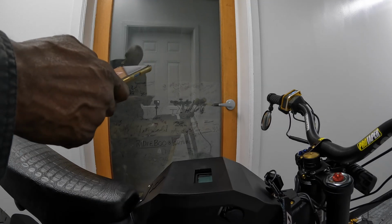Okay, we're connected. Okay, I gotta set max DC current. I got set to 280 amps. Max phase is 650 amps. Max RPM is 1200. And got the throttle. Got it ramped up, starting at 74%. I gotta redo this throttle thing. Okay, that's the throttle set up.